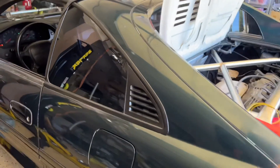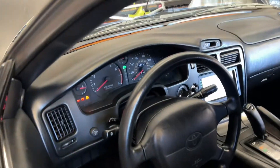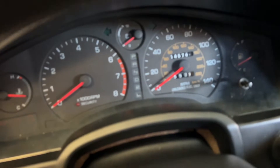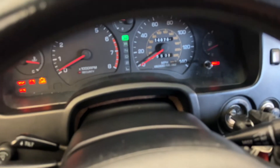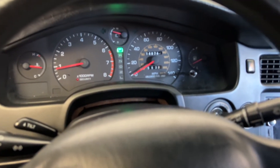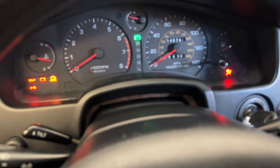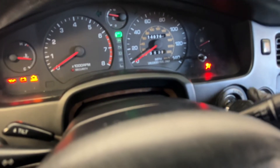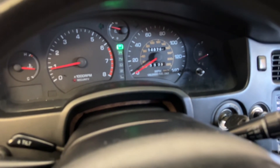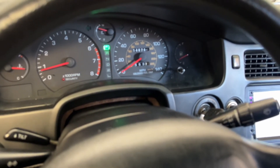Let's go ahead and start it again. Turn it off, turn it back on. That's it — the light's off. Turn it off, ACC, you see the airbag light — start it — and the airbag light's off. That's how we reset the airbag light.